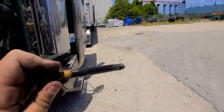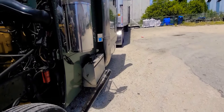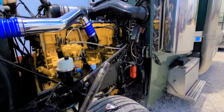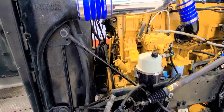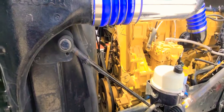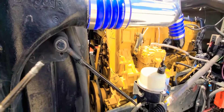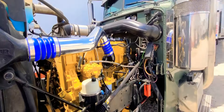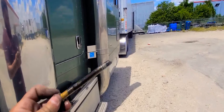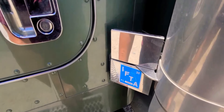My bolt is full of oil. When I rebuilt the motor I had Teflon, thinking that would help — it helped a little bit, but not enough. At the end of the day it went through again. Now my next step is I'm gonna clean all that up with brake cleaner, and then after that I'm gonna go ahead and put some of the silicone in there.